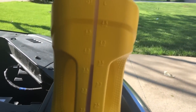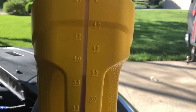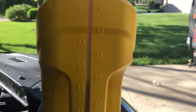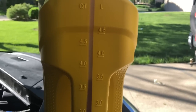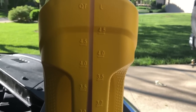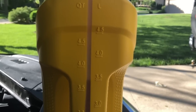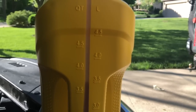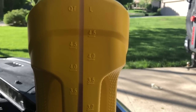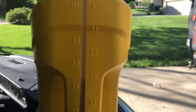For the record, we did five quarts and that came out to just shy of six and a half quarts total. Even though the owner's manual says 6.8, that would have probably taken me over full in this particular case, which means there's some original oil still in the engine. That gives you an idea of why you don't want to automatically go by the spec in the owner's manual — take the time to add it gradually and feel out where you need to be.